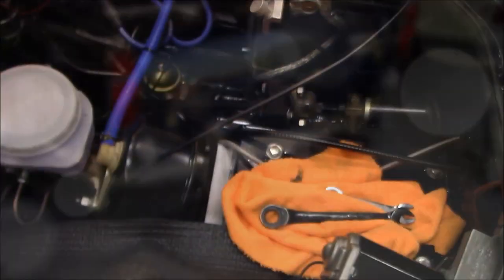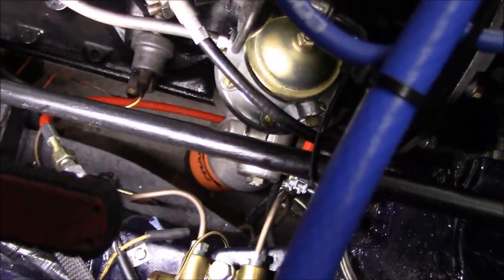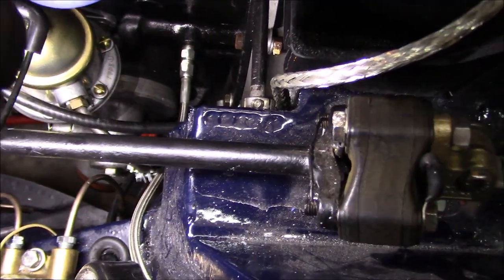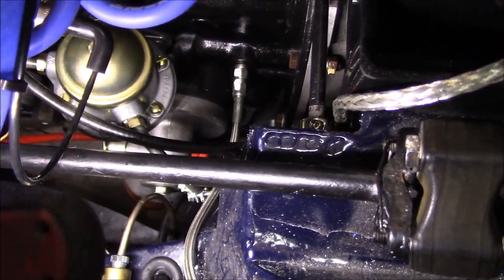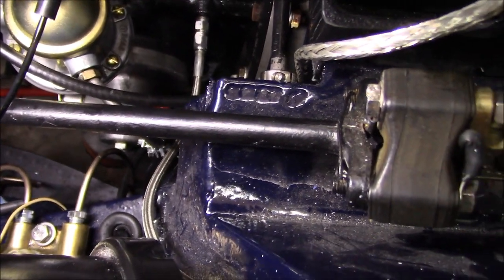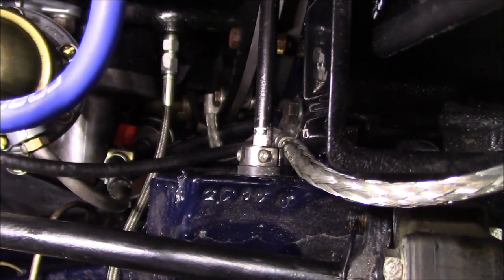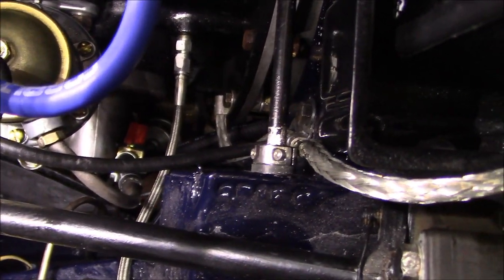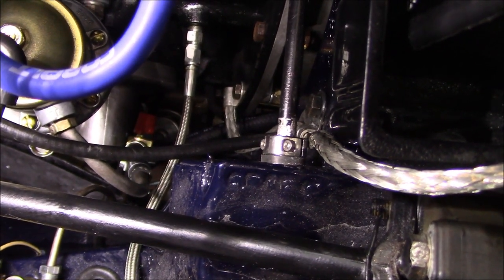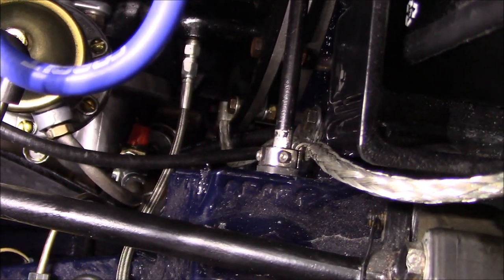On to the next project. It's 7 p.m. and we're doing a bit of a dirty job - removing that fuel line as we talked about. We're bringing it over to a more open area versus being crammed down there. We've cut the bottom fuel line and spliced in another piece of line. We're about to undo the hard line at the pump, pull out the old filter and inline shutoff valve, and probably turn the hard pipe at the pump to the left, trim it down a bit, then replumb everything.